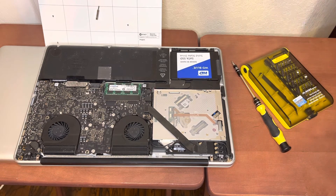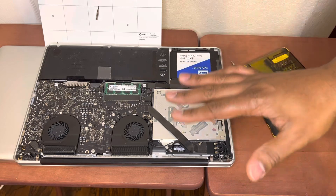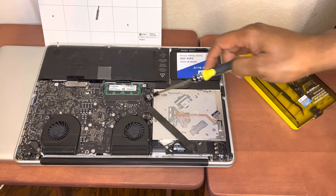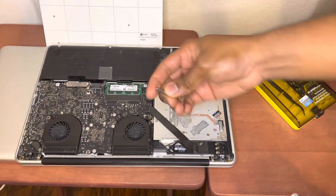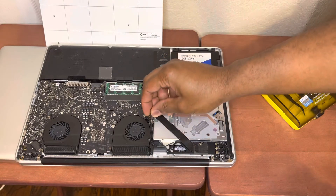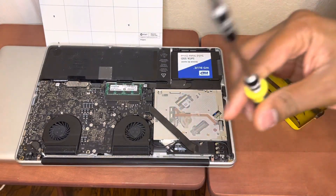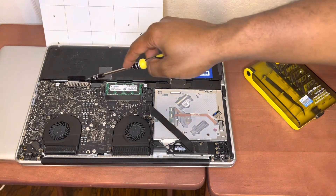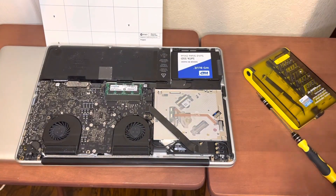Thank you to the commenter — his name was Silver Hinky — if you're watching this, thank you brother. I really appreciate your help and I hope this helps somebody else. If you build things often, this is pretty easy to do. Just take your time, because Apple uses different screws — the Phillips gets the case off, and the T6 covers everything inside. Switch back and forth between those two, and with the magnetic screwdriver, these tiny screws are no problem. The cooling is a lot better and I'm happy. Thanks for watching!